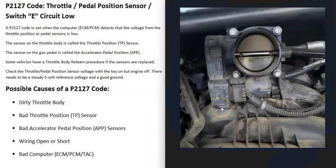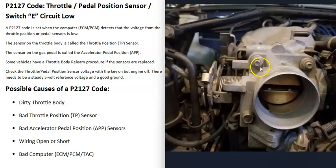Basically, an engine has what's called a throttle body, and this is where all the air goes into the engine. It's controlled by a little butterfly plate. As the gas pedal is pressed, this plate opens up to let more air in. When throttle bodies were first introduced, they used a cable that went down to the gas pedal, and when the pedal was pressed it would pull on the cable to open that butterfly plate.